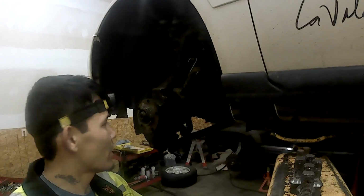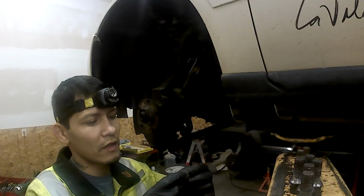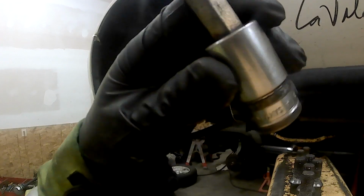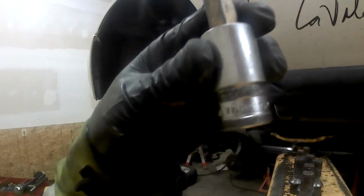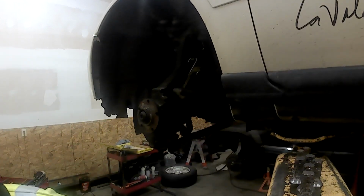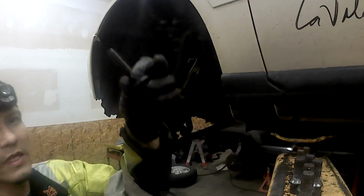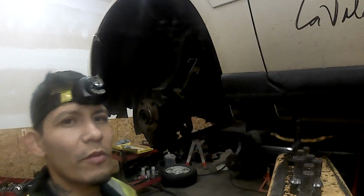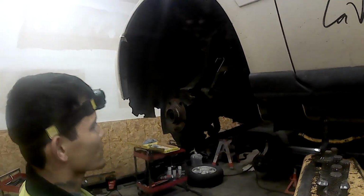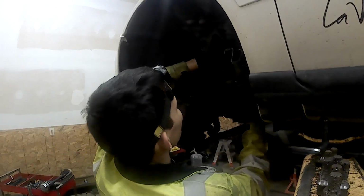Alright, so to get that center bolt off there, I'm going to be using a 14 right here. I don't know if you could all see it right here. It's more of a socket Allen wrench. 14 millimeter is what that is. We'll pull that off real quick. Get that out of there. There's that. Got it off. And remember, we're going to be replacing that one with a new one. So now that we got all that out of the way and all bungeed up out of our way there,